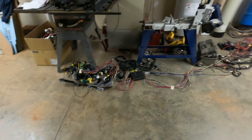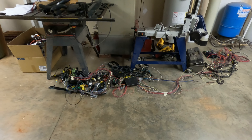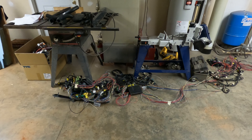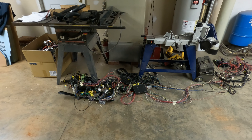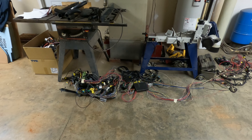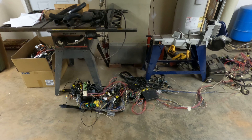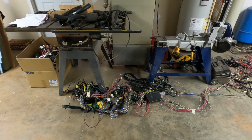I started out this week working on the wiring harness, trying to figure out if I could salvage it and utilize all the components. I never could get the computer to fire up and work trying to bypass all of the safety features on it — things like theft deterrent, security devices, steering column locks, and different communication between other computers and systems back and forth to the main computer. I tried bypassing those for many hours and just never could get the computer to come on and work, so I abandoned this idea.